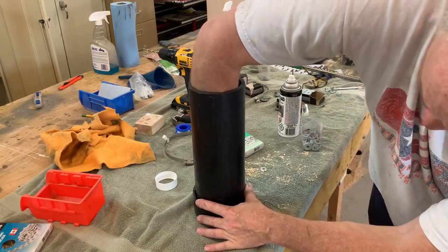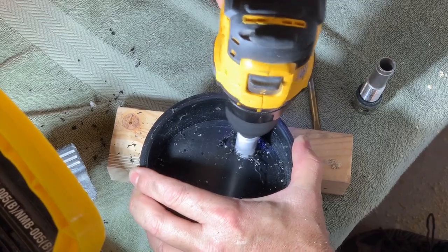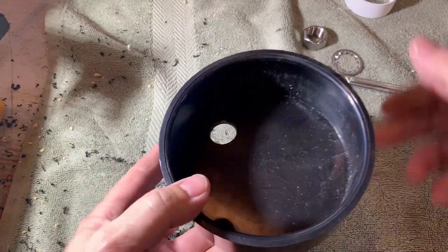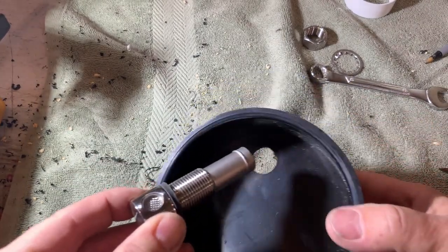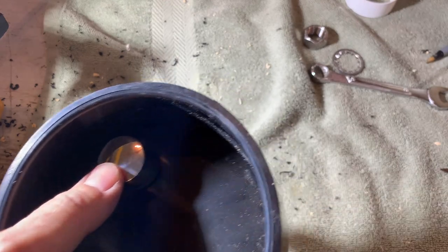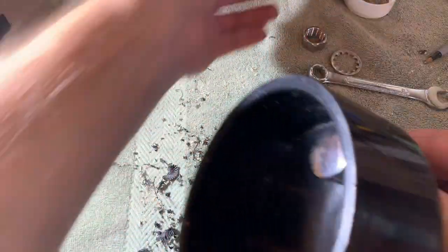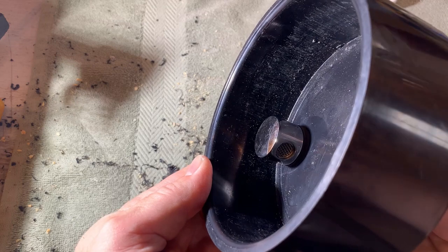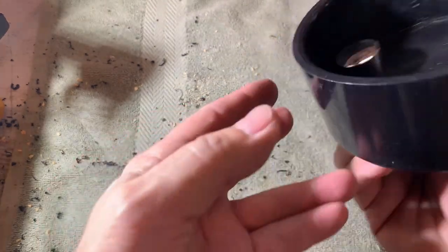Using a pen, I'm scribing the inside of the pipe wall to determine what offset to leave for the five-eighths-inch fuel vent fitting. This is our tank vent hole — it'll be the highest location in the tank. I've left just enough clearance to slip over top of the tank. Inside you can see the two vents, and they're going to be placed in the up position to ensure we're left with just a very small pocket of air in the tank. I'll tighten it in that position.